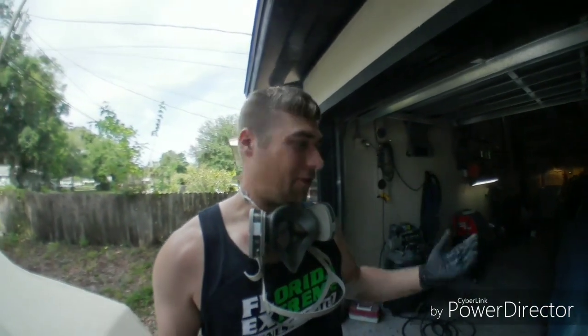But anyways, it is a pretty good sander. It does sand pretty flat. Foam on the bottom, though, it contours to things, so it's either good or bad for you. If you want it super rigid, I don't know if they make one that's super rigid, but you could always fashion something up on there. You could take the foam off. I'd leave it on there, man. It's not a big deal. I'm using it right now for the rough sand downs on the heavier grits, and then doing the rest of it by hand with the finer grits with a longboard Durablock.